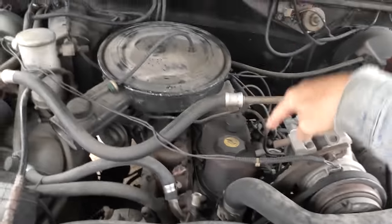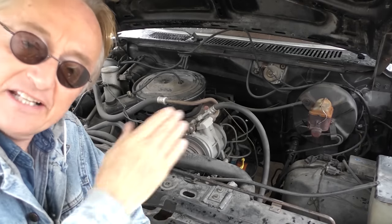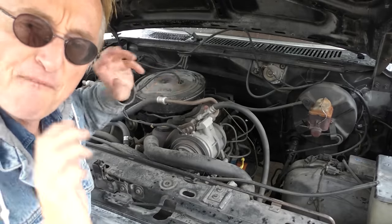The reason I say it's a good cheap work truck is under the hood — a 300 cubic inch straight-6 cylinder Ford engine. Now they're not insane horsepower; they go anywhere from about 100 to 175 horsepower. But they've got a lot of low-end torque for pulling stuff, so much so that Ford actually put them in dump trucks. You see them in wood chippers, dump trucks, you name it. This one is an F100 from 1981, and it's a typical rolling 300 straight-6 — they've got a little roll to them, but they can run forever.